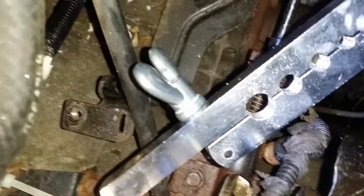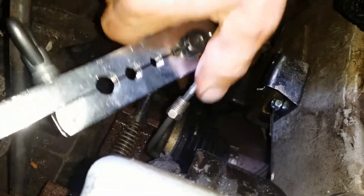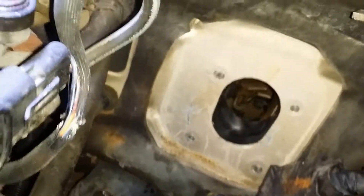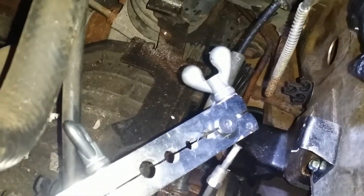There's another line coming in from over here that I extended so I could wrap it around the booster a little better. Next, there's the line from the back which I've already put a flare on. So that's going to be four lines — one, two, three, and then this one coming across the top that needs to be bent. The cool thing about three-sixteenths inch lines is that you can just bend them by hand — you really don't need the special tool, although I have the special tool.